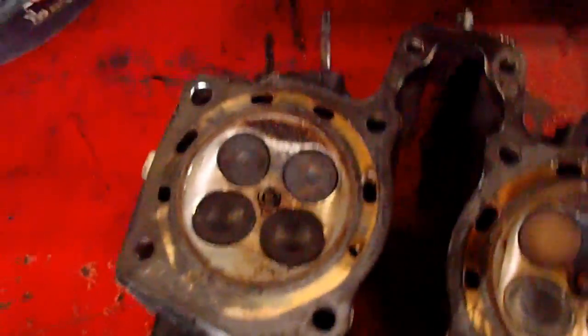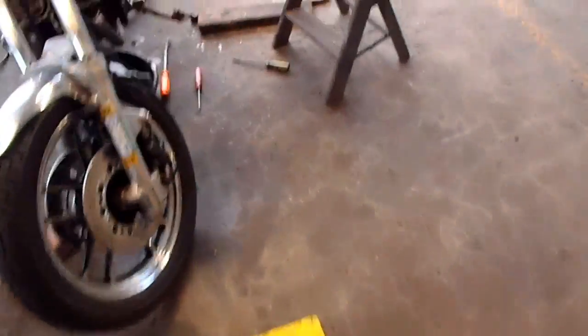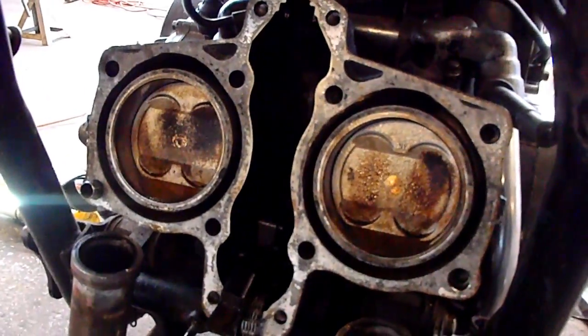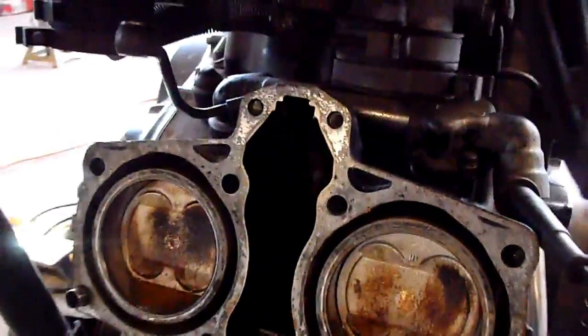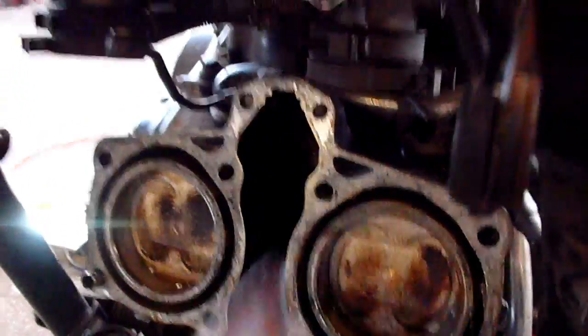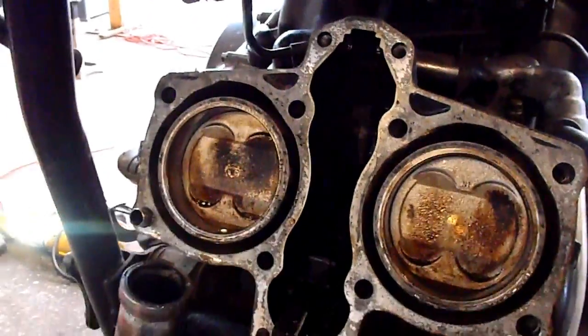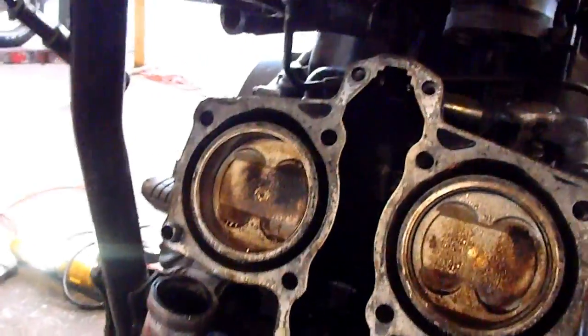I can't tell where the water leak is, but I assume it is on this cylinder - this was the easy cylinder to do with the engine in place. There's the engine, just the tops of the heads. This water would have gotten there from pulling the head, so you can't tell - this is not evidence that it leaked, because when the head was popped, additional water cleared. Hopefully it's simply a matter of the repair. I got a dowel pin over there, the other one remains on the head.